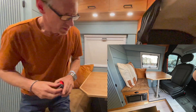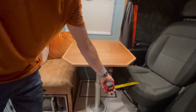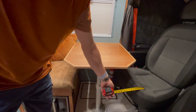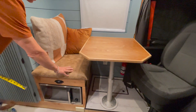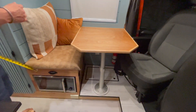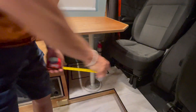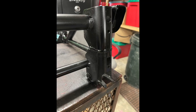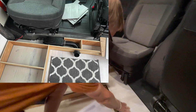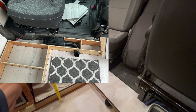You have to have a driver's seat on a swivel, and everything is based off the driver's seat — the height of the table and the height of the bench are both based off it. If you have a ProMaster, you may want to consider lowering the seat. I lowered mine three inches, and the swivel raises it one inch, so I cut the bases down three inches.